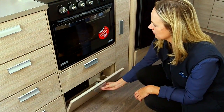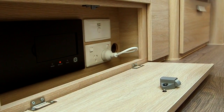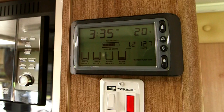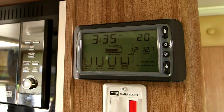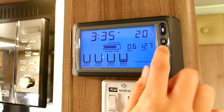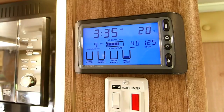Your dealer should have explained your isolating switch location to you. Turn on the isolating switch — this will turn on 12 volt to the RV. The Drifter control panel monitors water tank levels and the 12 volt battery charge state. It will show you the volts and the amps in your battery. The switch on the top is your battery switch, which will either turn on your battery power or isolate it. If the battery is off, the screen will say battery off and the water pump off. To turn on the battery, flick the battery switch down. The battery switch needs to be on to charge up any power source. The bottom switch is your water pump switch, which will turn on your 12 volt water power. Flick the switch down to bring up your tank water levels.